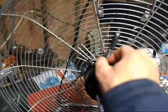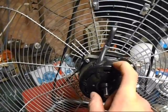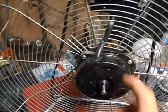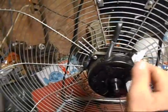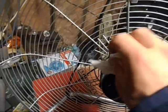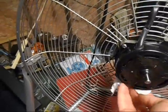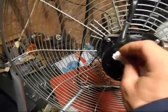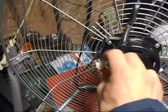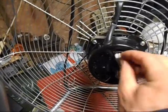You could try to turn it and force it to get this cover up over the wire, but I wouldn't, because you may accidentally ruin the connections in the windings. I overemphasize the importance of not hurting the windings at all, because they are really easy to hurt. I've done it before and it just totally kills the fan — especially a fan like this. I paid $90 for the thing.